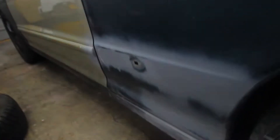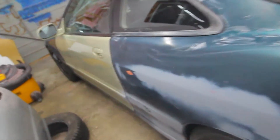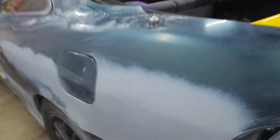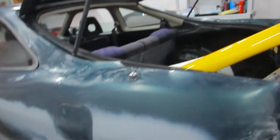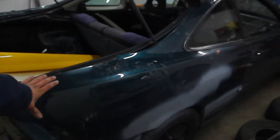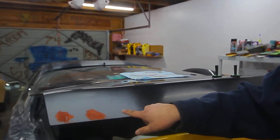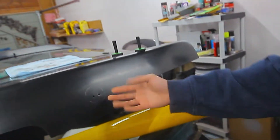I had to take the wrap off and I was pissed because on the side molding hole, the Bondo literally just popped off while I was wet sanding it — fell off inside. I don't want to go through taking out the entire interior again, so I kind of just punched through the sides and hopefully we can fill it with Bondo and cover it up. I'm not happy with how this side is turning out. There's a dent — you might not see it but I can feel it. It's not completely straight or curved. I left it. When I removed the Acura emblem there was a hole, so we patched that up with Bondo — still gotta sand it, but since we're putting on a new emblem it won't matter.